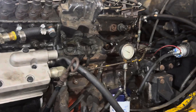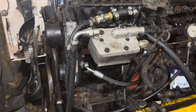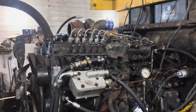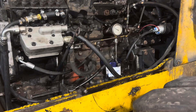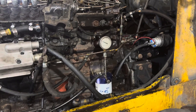Now we got everything ready to run — well, we've actually tried to start it, you'll see that. Got a lift pump mounted, air compressor mounted, everything plumbed for the air compressor, coolant lines, oil line. We took off our turbo piping to spray ether, and looked at the valve lid back off to double-check timing because we can't get her to run. Got a fuel filter — the one I had on a common rail Cummins takes a CAT filter.